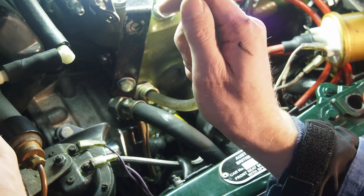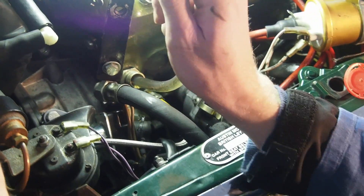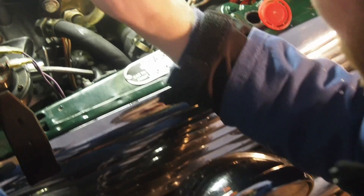This takes a little while, especially when the oil is cold as it was today. We're now pushing the car backwards in fourth gear while feeding the oil pump with oil — it basically reprimes it.